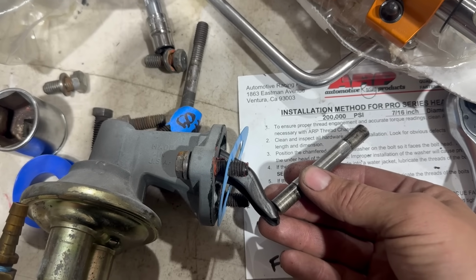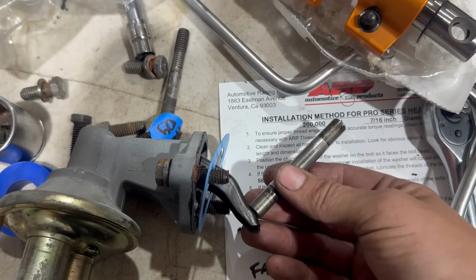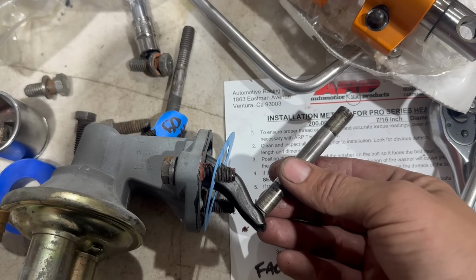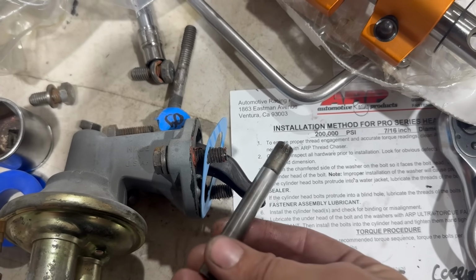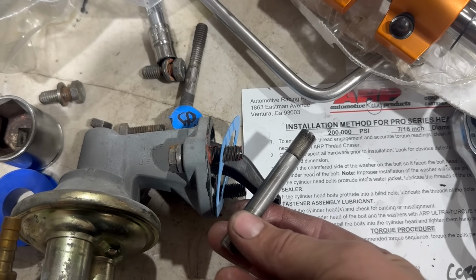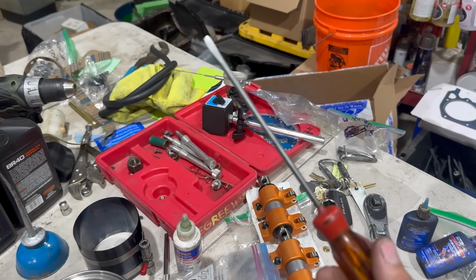Once the two pieces are mated together inside of the engine, they're going to look kind of like this. Now you can see how installing this pump would be difficult, because when there's no tang here to hold it, this push rod just falls down and completely blocks your ability to install this pump. So typically you'll hold it up in there with a pick or a long screwdriver like this or something.